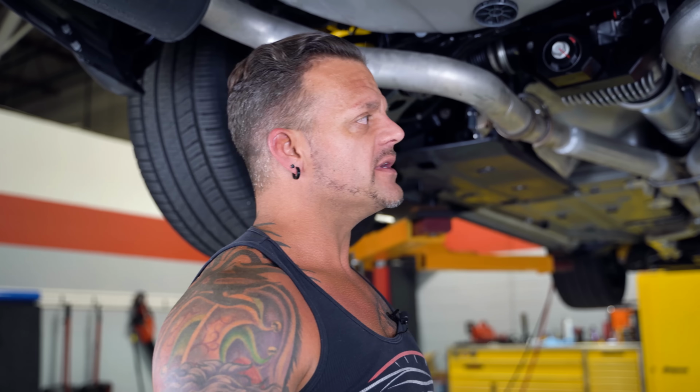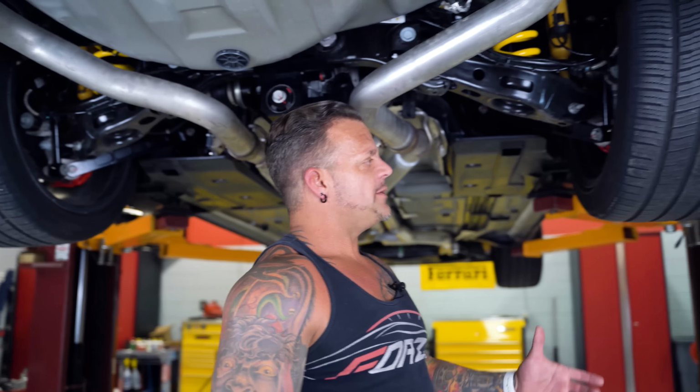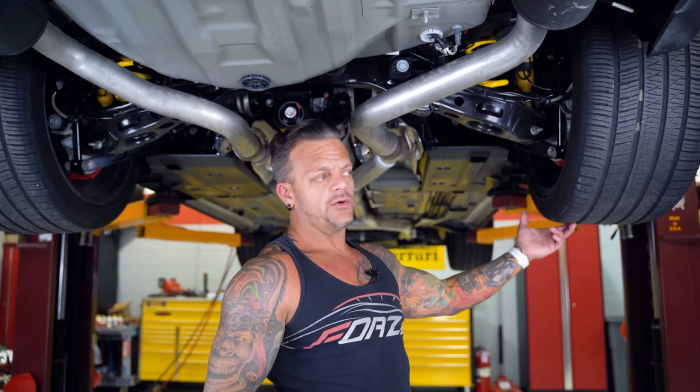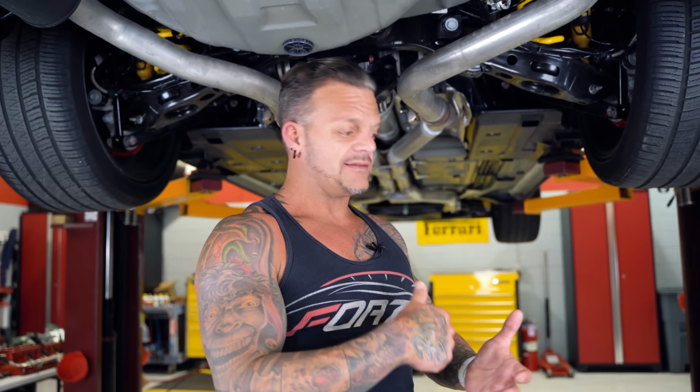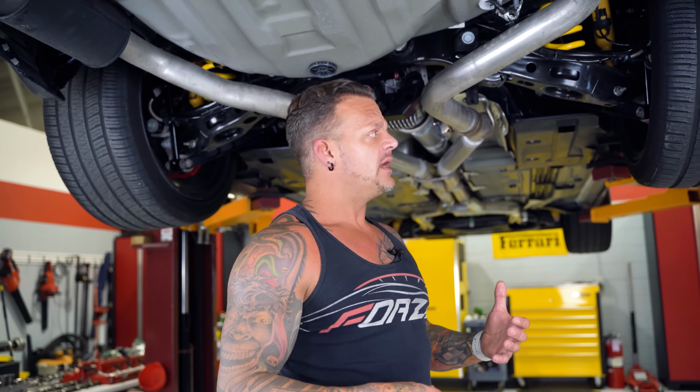So for those of y'all, I don't mean to dummy it down because I know a lot of y'all that watch this channel are car enthusiasts and you're super knowledgeable, but there's some people that don't know what wheel hop is. So wheel hop is typically when you put a drag radial tire on that's sticky, or you're at the drag strip where the surface is real sticky, you take off, okay, and initially the tire breaks traction. When it regains traction, it grabs to the ground, okay, and it's very abrupt, it's a shock to the drive line. It transfers a tremendous torque load to everything, and then it will pop off the ground and do it again, okay?